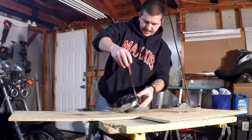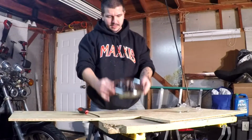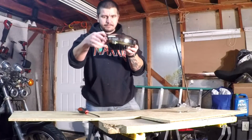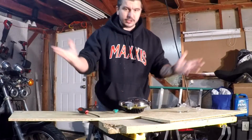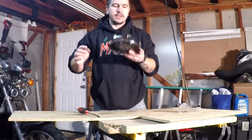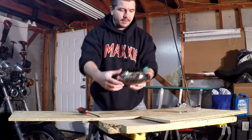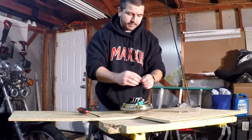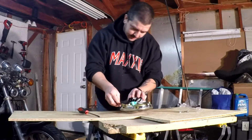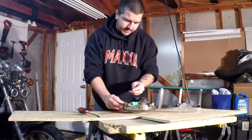Once you actually get the alignment screw in, screw it in to the point where it looks somewhat straight, and then we can adjust it as we go through. Now, so long as that is aligned, you'll have these two little holes lined up, and that's where we can put in these little retaining screws to put everything together, with these little washers at the end of them.